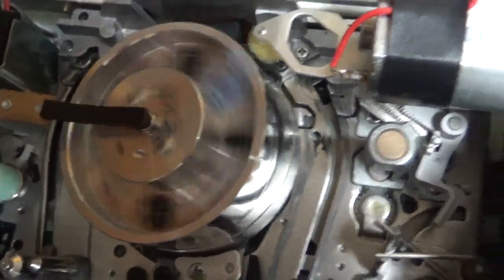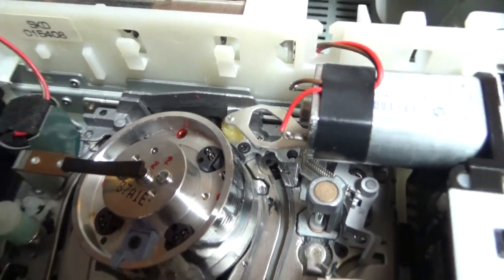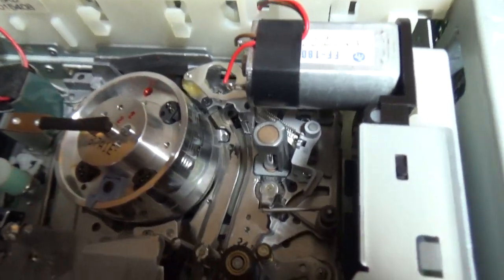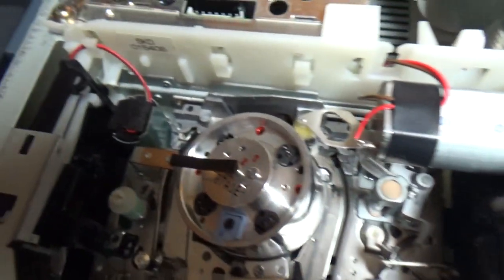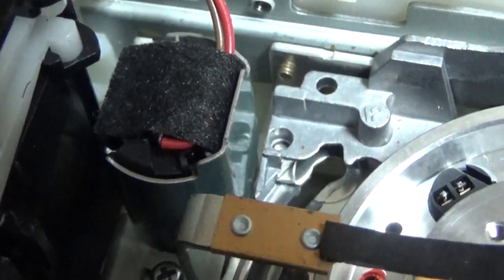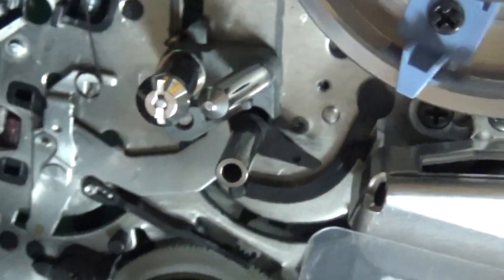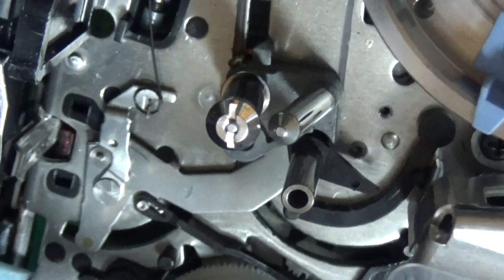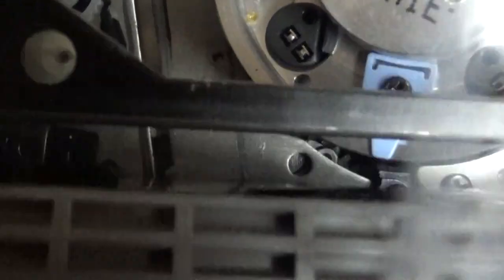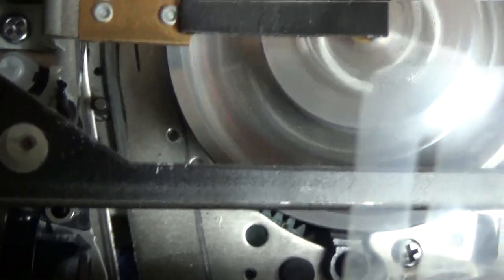There you have this small drum, and here you have an auto head cleaner. Dr. Sony probably noted this — so if the auto head cleaner is still there I'm guessing it's good; he's not going to sell me a VCR with a rotten auto head cleaner. At the rear left side, you have the loading motor placed vertically downwards. It drives a worm gear and shaft, which drives cam gears on the bottom — you can actually see one of them here. I'll insert the tape again to let you see that part.